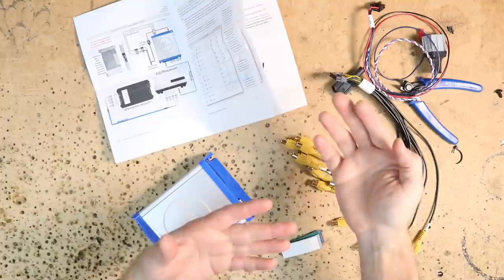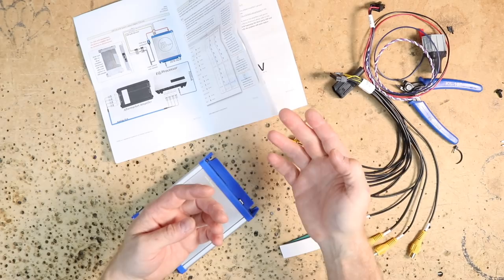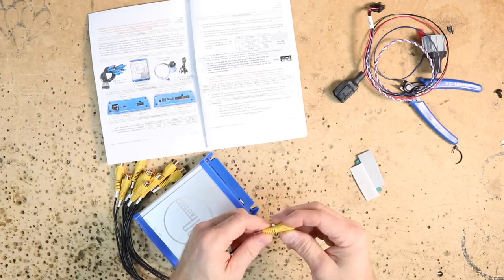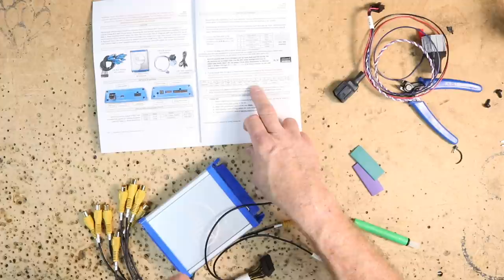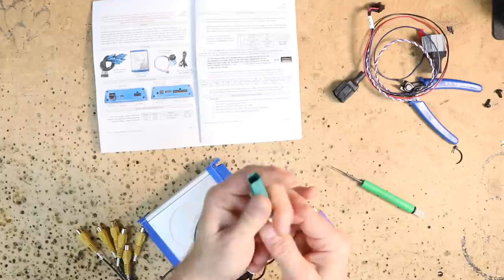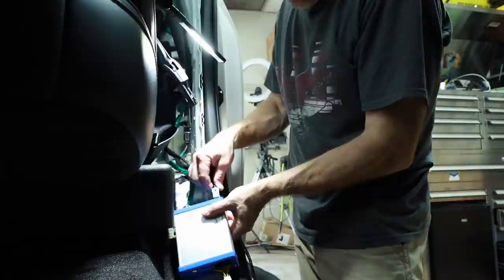For the install we're doing in this car, we're going with an external DSP that has four channels of input, front and rear. It creates a sixth channel subwoofer output. Seeing how this has so many outputs, I'm going to put some shrink wrap over the RCAs we're going to be using. One is left front, which in our world is white. Two will be gray. Rear is seven and eight — eight is right rear door, that's purple; seven is going to be green. These are the standard wire colors for these corners of the car, just like a factory wiring harness adapter.